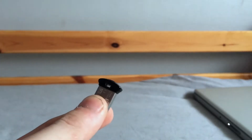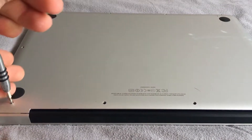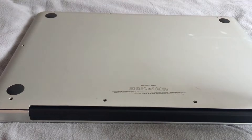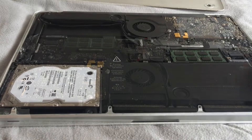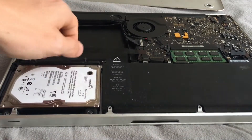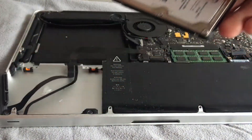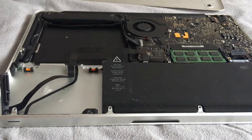Because this thing is currently a disaster of a MacBook, there are only three screws holding on the bottom cover. The first thing you want to do is unplug the battery, then remove the two screws holding on the hard drive, throw that away, unplug the SATA cable, and unscrew the ghetto hard drive mounts because you've lost them or it didn't come with them.